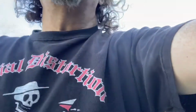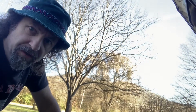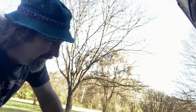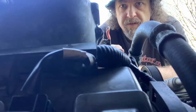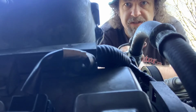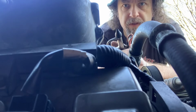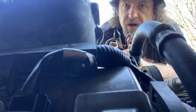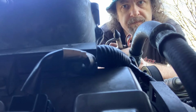That's good news. If it was a burnt piston ring, I was probably going to scrap the car, get something else, because I just don't feel like tearing the motor down far enough to put in a piston ring. So if the problem's just a burnt exhaust valve, why can't I just go to the junkyard and grab an entirely new rear bank head, or at least a junkyard one, check it out, make sure all its valves are good, and then swap the head? Why not?